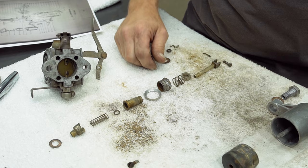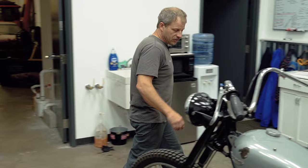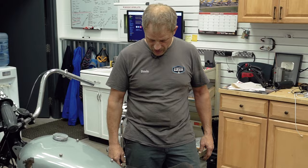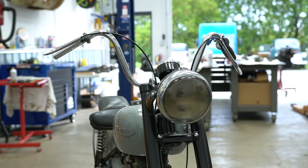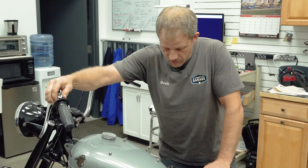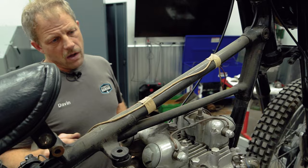In the meantime, I'm going to be over at the motorcycle itself and start getting it ready, because I can put the carburetor on last. I can get my magneto put back in, get my oil tank cleaned up and ready to go back in, and also get my brake and clutch cables in good shape. I have a fresh kill switch to go on here — this one is no good whatsoever. I'm not going to get too excited about a battery because the battery only runs the headlight. I don't need a battery to start it; it is magneto-based, so as long as I can kick it enough, it will spark.